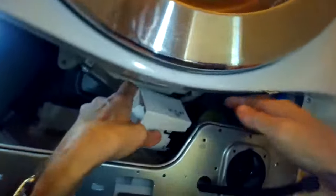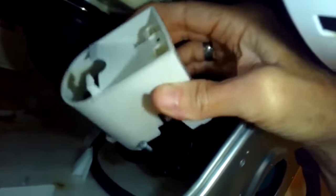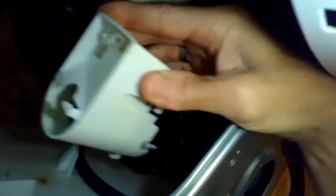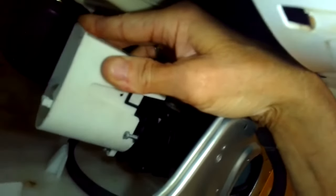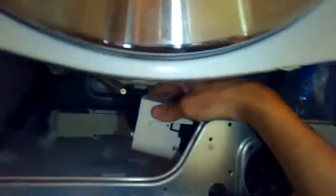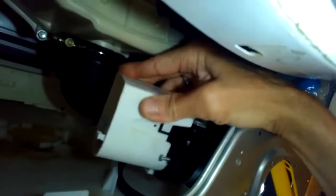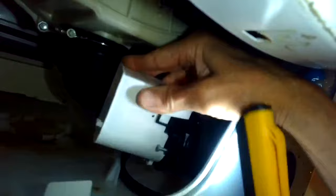We're going to put the pump in position, and it has 3 little protrusions that come out of the motor that help it to lock into the housing. There's 3 little holes in the housing. Actually, there's more holes in the housing, so you can kind of move the pump almost around anywhere you want. But the flat part of the motor should be pointing up toward 12 o'clock ideally. It's not that critical though. It could be off at a 45-degree angle.